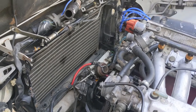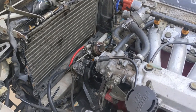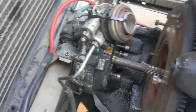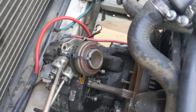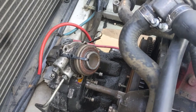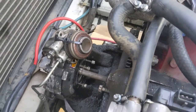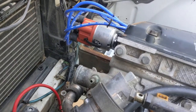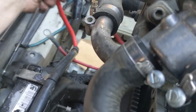We are ready, as far as I know, to pull this motor out of the car. It's three hours from about the time I started, including time to shoot video — it's not too much work. What you'll see in this last step: I went ahead and pulled the clutch out, reassembled the input shaft, and put all the bolts back where they came from so I don't have to figure out where they went later. I've zip-tied the throw-out bearing to the slave cylinder so it doesn't pop off — this only happened once but once was enough. Zip-tying it at least helps prevent that. This part now stays with the car.